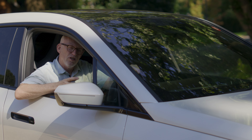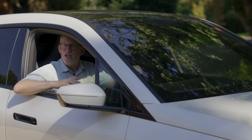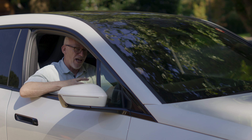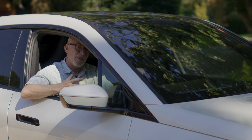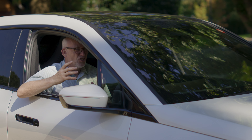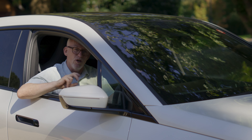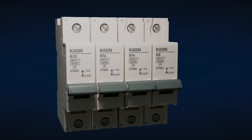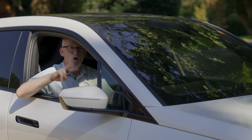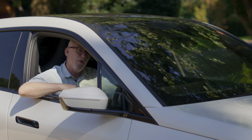Here's the issue: you've just returned from a long drive, you're low on charge, and you need to go on holiday tomorrow. If you take the standard BMW approach that's two kilowatts, and with a 77 kilowatt-hour battery, 10 hours gives you just 26 percent. You could set both chargers to four kilowatts, but then you run the risk of charging both cars together, tripping the 32 amp breaker, and ending up with both cars uncharged — and none of the doors working.